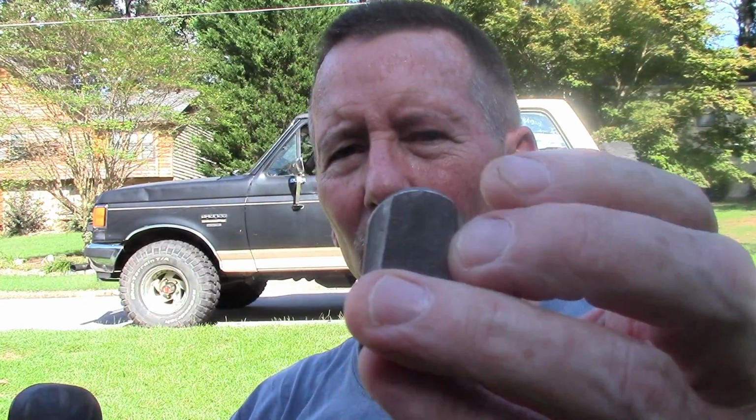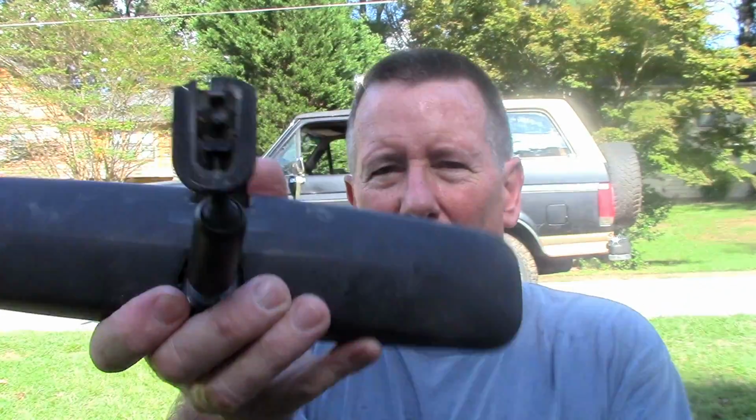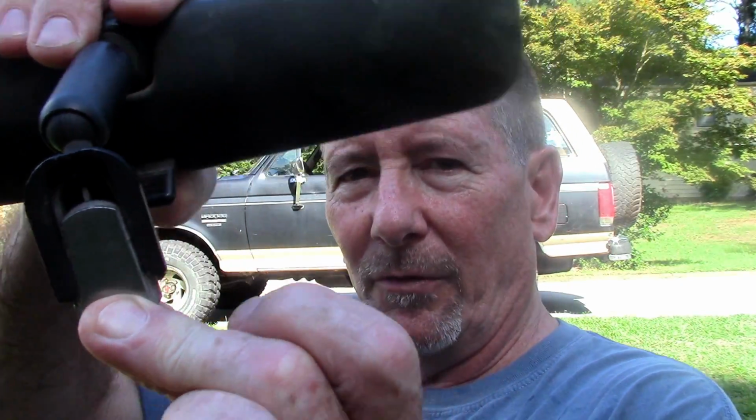First of all, really important, I know this may seem obvious, but you want to make sure that you have the little bracket, the little button, oriented properly on the window, because obviously your mirror is going to slide down on top of it like this, and it's got these little flanges on it. Your mirror is going to slide down on top just like that. Bam.